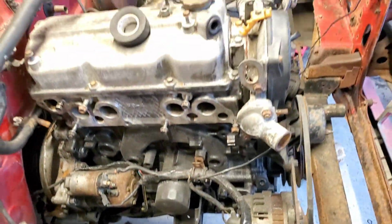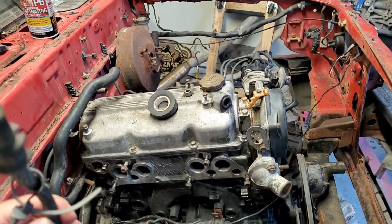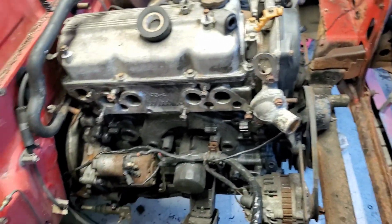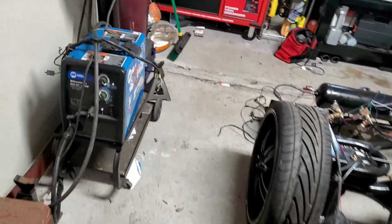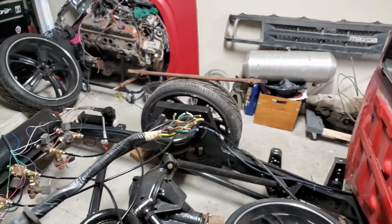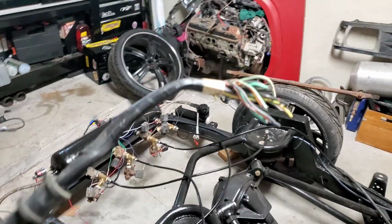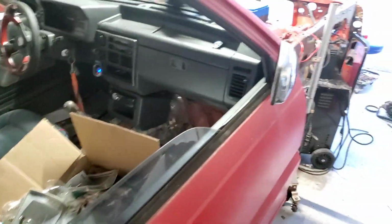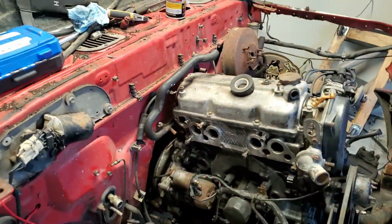And I don't know if you need all the wiring from the ECU to run the factory carburetor, because I cut my existing stuff, and I think all this goes to the carburetor. But I was able to get the one off the other truck. My buddy cut his off because he didn't use it, because he went with the V6. So he cut off all the plugs for me, and these all go to the carburetor. And they're all color-coded wires, so if I had to, I'd just tie them together, just temporary, just to see how it goes. But I think that's gonna be my next mission.